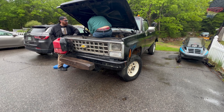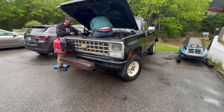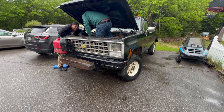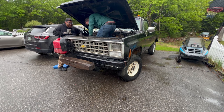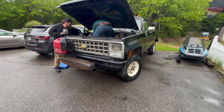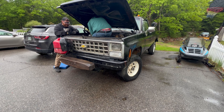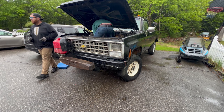There's one washer on the one that holds the throttle assembly in the back, and that also has a pin — that shouldn't lift like this. As I took this out, the car lifted it. That's strange. It couldn't have been an installer problem, I don't think so — I did it myself. This is loose. I didn't even put the wrench on it. It's coming out by hand. It probably loosened up after you took the front ones off because it lifted.